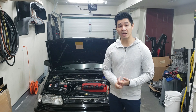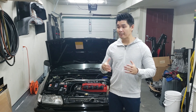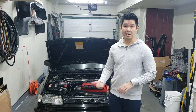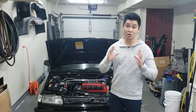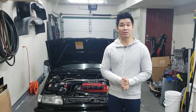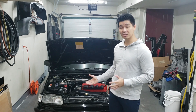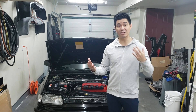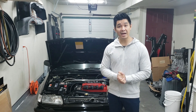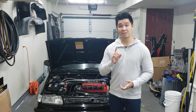That covers the engine wiring, vacuum lines, fuel lines, and all the parts required to get the D16Y8 swapped into an EF chassis. One of the most common mistakes is trying to adapt the D16Y8 engine harness into the EF chassis — it doesn't work that way and requires a lot more cutting and modifications. I highly recommend starting with your original engine harness, changing or adding a few plugs, and it's a direct plug and play. Also, if you have a choice between a Y8 or a Z6, I highly recommend the Z6 — it's a far better and better-built engine, and a far simpler swap. You just swap it in, plug in the P28 without any tuning, and drive.